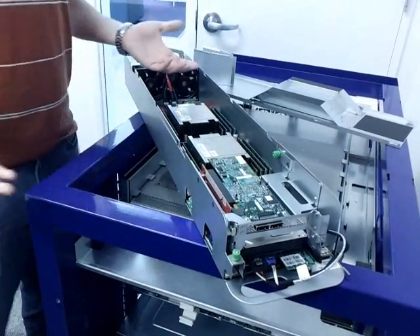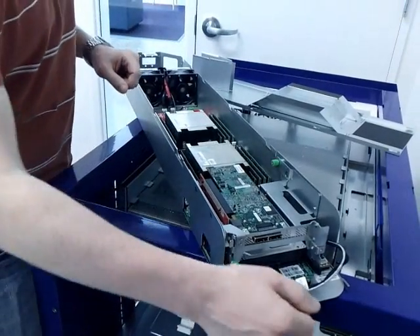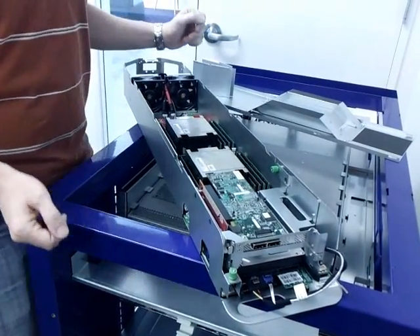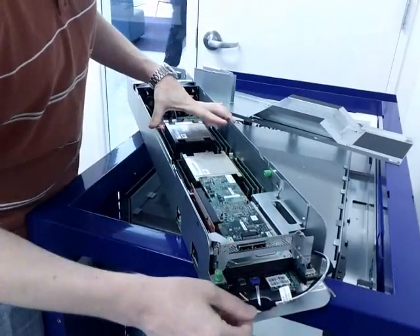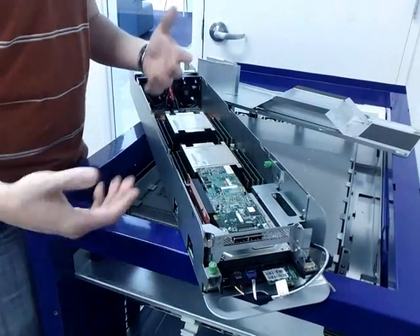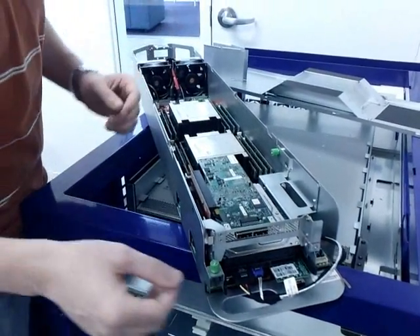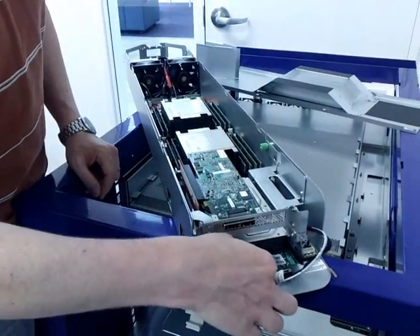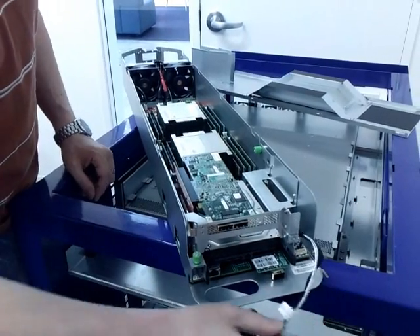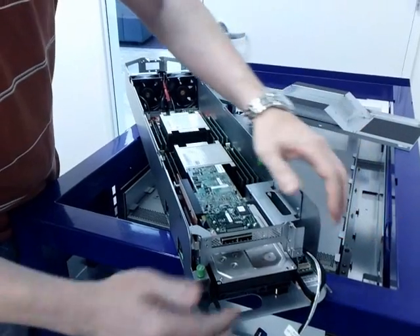The tray itself can be swapped as a unit or moved to a new location with no external connections except for one network cable in the front and, of course, power in the back. By moving the drive on the tray, we actually don't use a drive backplane, because it adds cost and complexity. It's a single-drive machine, so you'd only ever cold-swap it — you don't need the hot-swap features. You can simply remove the power and data cables and pull the drive out of the front of the machine; it's a simple tool-free swap.